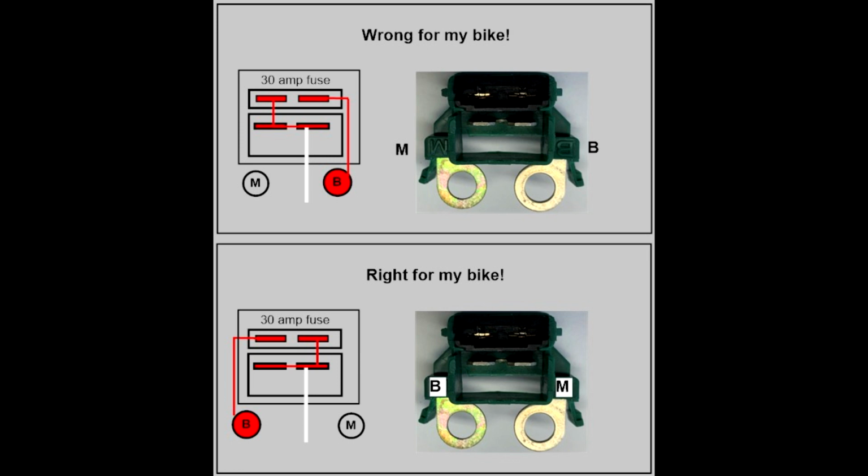So when I got on Amazon, I found several solenoids that claimed to fit my bike. Most were $8, one was $12. So I mindlessly ordered one of the $8 units, installed it, turned the key on, and nothing. Long story short, I found that all of the $8 units were for some other applications where the terminals were reversed for my application. The $12 unit had the terminals placed correctly. Now I'm going to have to go through the return, order, wait thing.